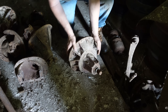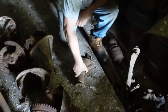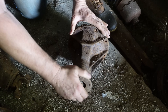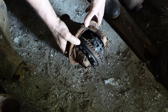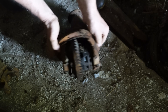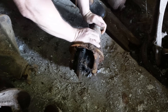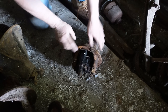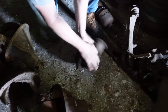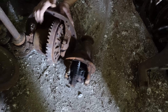So not the same as an Olds, a Pontiac, a Chevy, or even Cadillac — Buick had their own weird thing going on with torque tubes up till 1961 or '62. For comparison, this is out of probably a Nash Metropolitan. Tiny little thing, kind of cute in a weird way. But I have a feeling I know why Warren D kept this one — this is a limited slip. You can see the clutch unit inside. Little clutches inside. This might have been from a British sports car, an MG perhaps, or an Austin. But the Nash Metropolitan used a similar diff — I'm going to bet that's what that is. Look at the size of the ring gears on these things — how different could they be? Holy smokes.